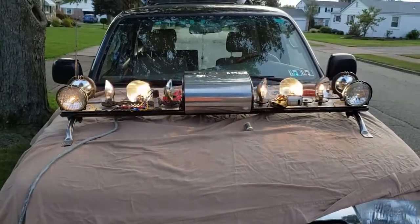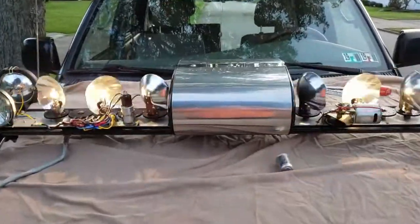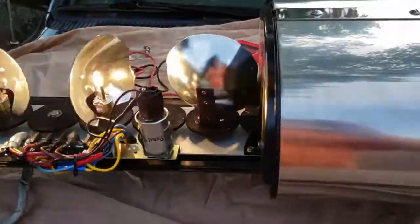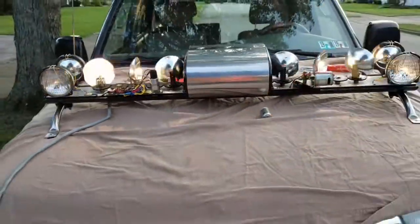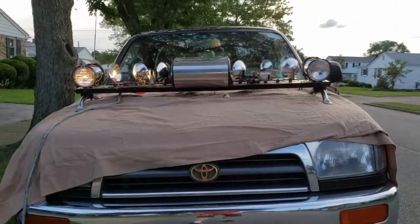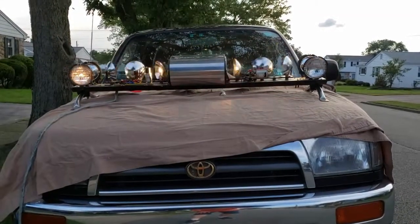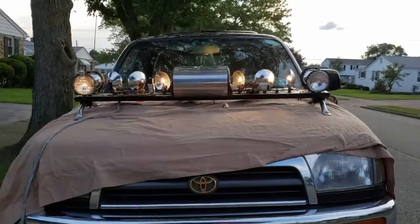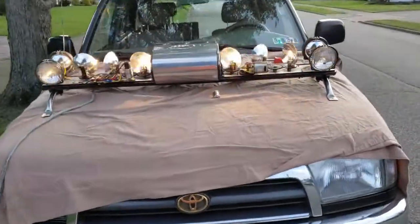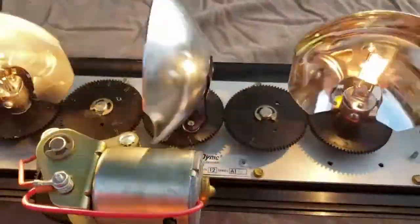So literally the flasher is pulling up left-right, left-right. In a typical can flasher or thermal flasher fashion it does not generally have an even flash pattern. What's kind of neat about this is the factory flash pattern when I got the bar — it's going outside, then staggered in: outside, middle, and then slowly in. It's kind of neat actually; I think I'm gonna keep it like that.